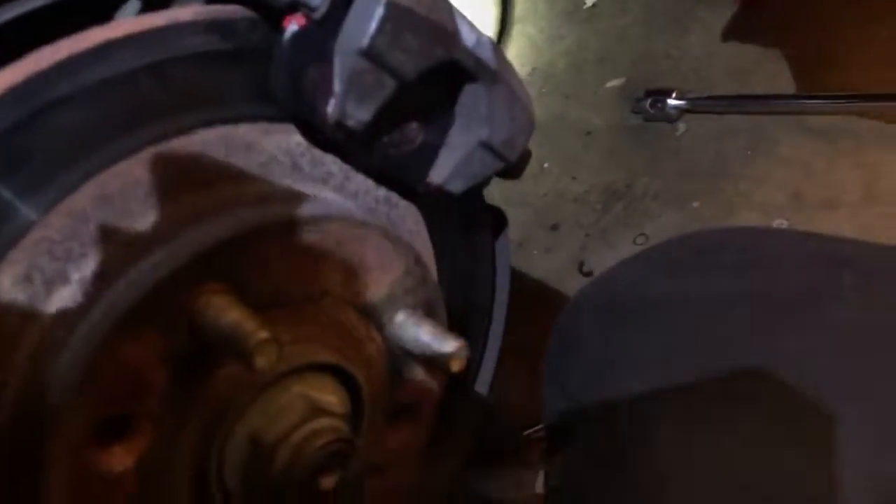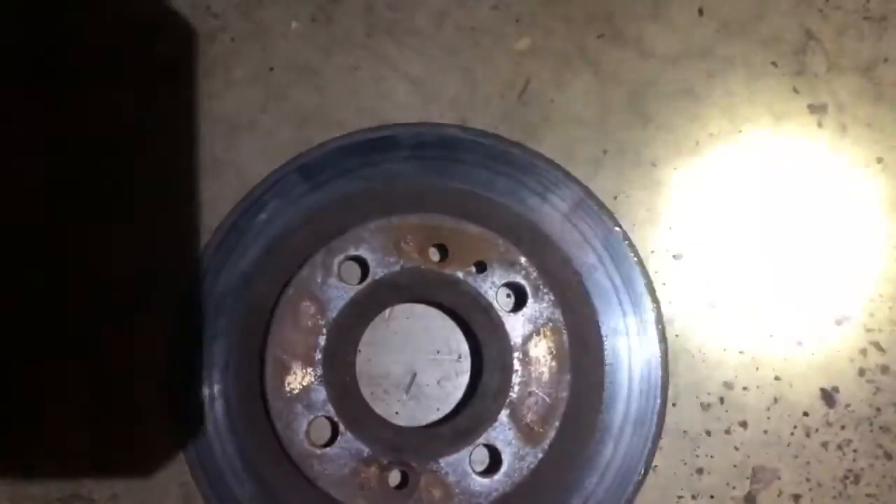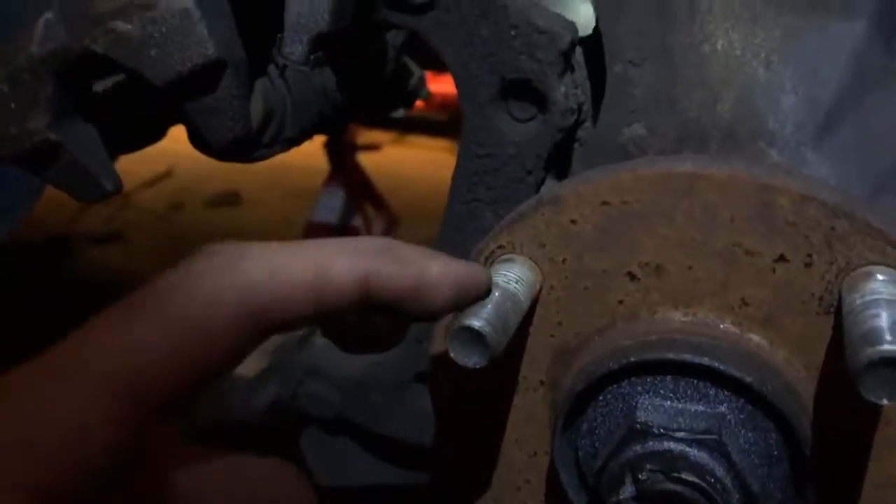On this side the caliper doesn't want to come out. Looking at the brake pads over here — you can see the brake pads are pretty much new, but look at the rotor, it's pretty rusted out. The caliper seems frozen in there, which is probably why the pads are newer on this side and the e-brake on this wheel never wants to work. I'm just going to get a brand new caliper — I'm heading to work right now and I'll order one.